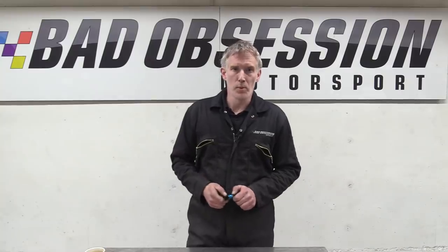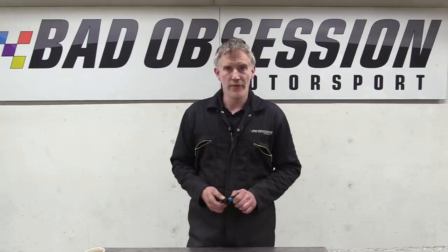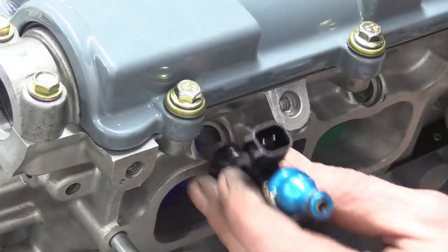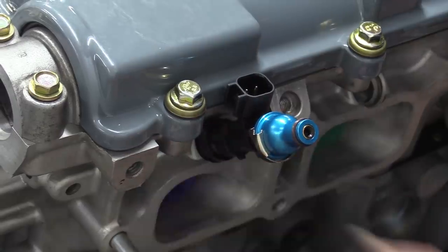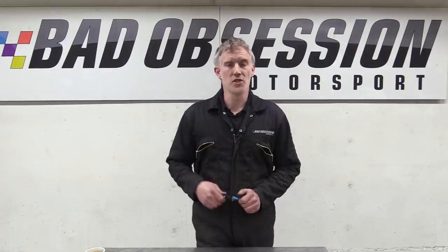No, we wouldn't have had this problem had we just bought an off-the-shelf kit, but way back then, we just couldn't find one. The fuel rail came with these little adapters for the 3S head, and it all fits fine, except for the injector hat being too small for the fuel rail. A simple enough problem to sort out, so my colleague went off on a quest to find me a set of adapters with a bigger O-ring, which, in fairness, he did.